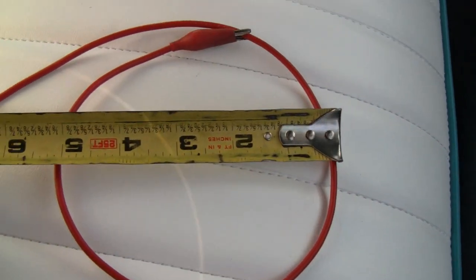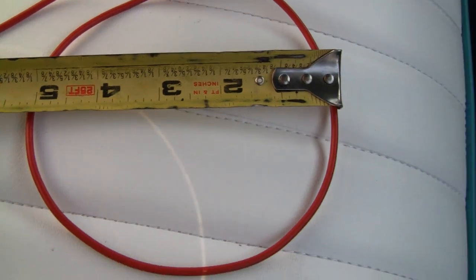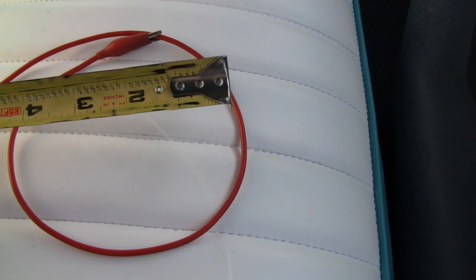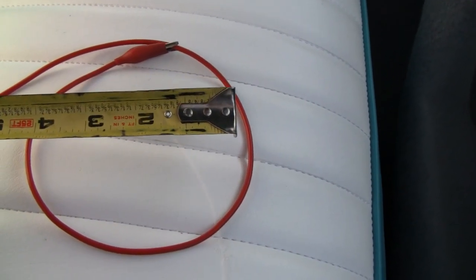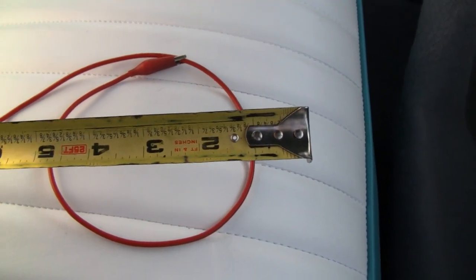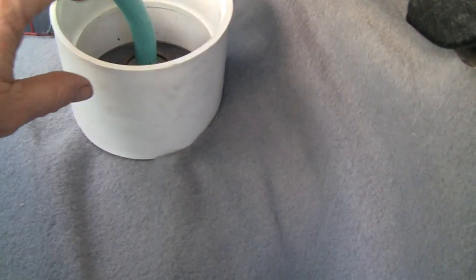Alright, so here we are. I took that off, and looks like we'll be dealing with roughly the inside hole. Should be roughly around 5 1/4, and that's what we guessed when we had the piece of sheet metal out there. So, all right, let's go in there and make an escutcheon, and then we'll make the rag boot. All right, we'll see you inside. Found a piece of PVC pipe connector inside the garage there, and this is from one end to the other is 5 inches, and I stuck it in a hole here, and it just about fits.